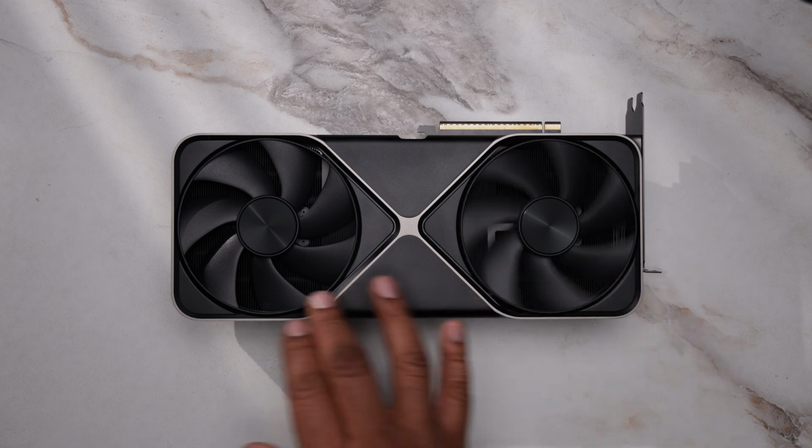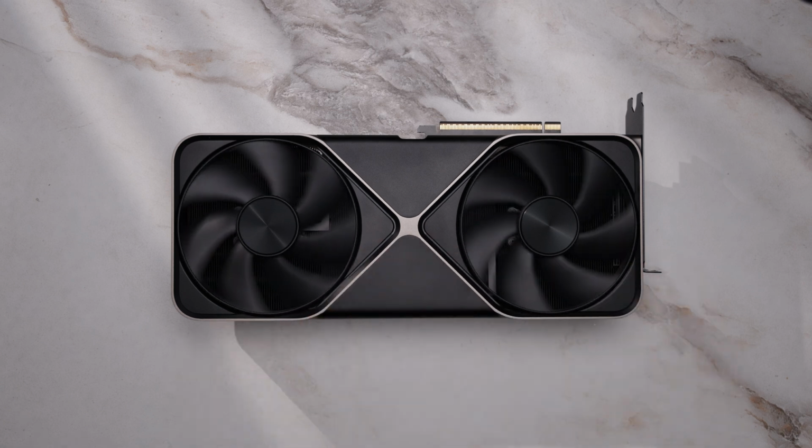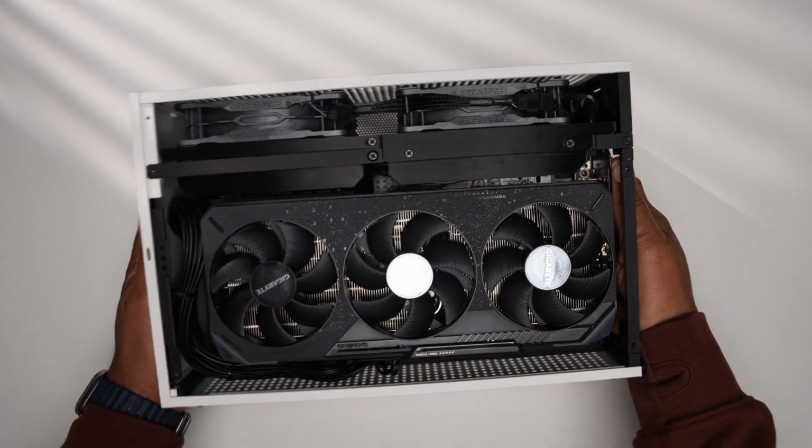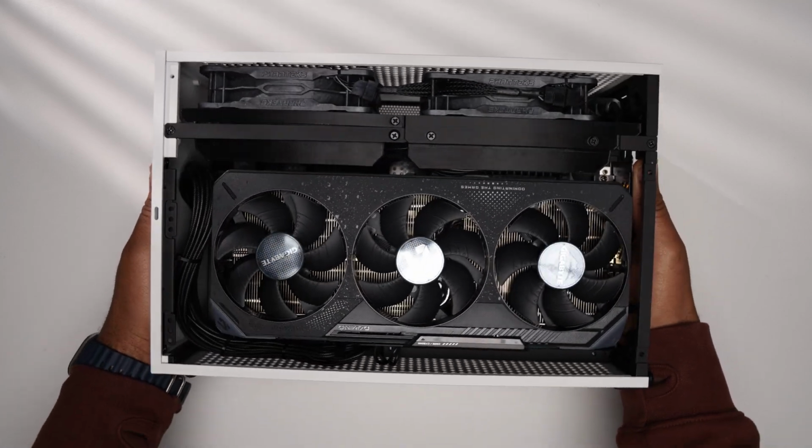I'll stick with my RTX 5080 FE for video editing, as it has two 4:2:2 10-bit encoders and decoders, and a 9070 or 9070 XT for 1440p or 4K gaming. I wish AMD offered a Founders option. Their previous cards look pretty awesome. The best looking 9070 XT in my opinion is the Nitro+ from Sapphire.